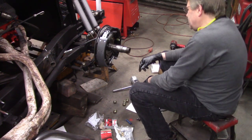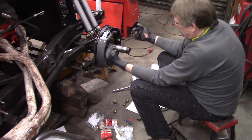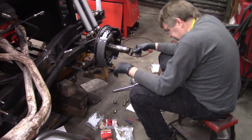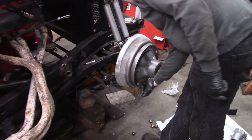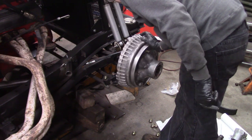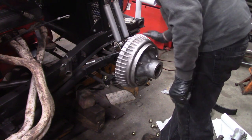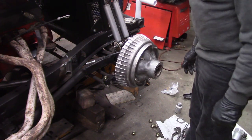That's good. Hopefully when you step on the brakes, these are the right springs to pull everything away from the drum — we're going to go with that. I finally got the brake shoes to sit where they belong and I've got some nice free rotation. The bearing is just snug and I'm going to go ahead and put the brake adjuster spoon in there and get some drag on it and just see what's happening.